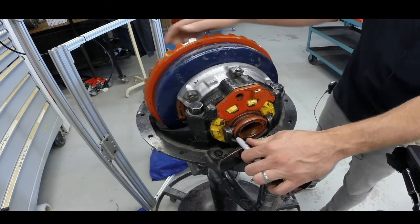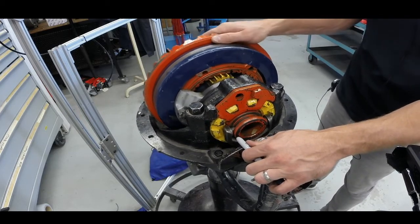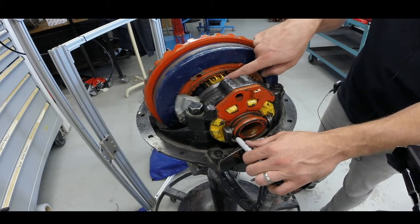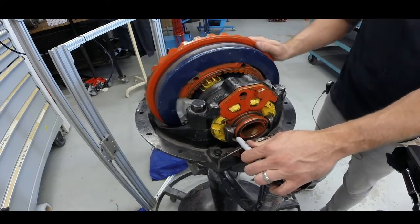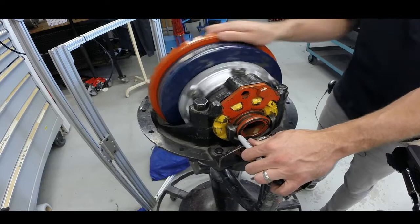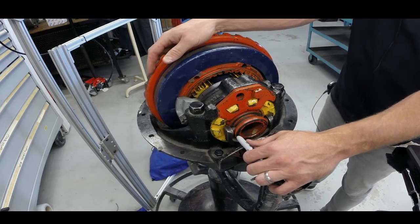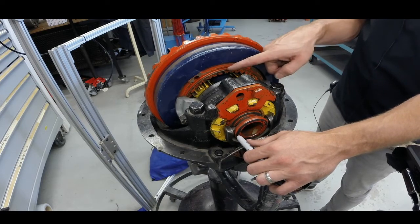I'll rotate all the way around. We're back at the top of the cutaway and our mark for our carrier and our pinion gear are gone. If we just keep rotating, eventually they may come back to us. What that's showing us is that in our low gear of our planetary two-speed, the carrier being the output rotates independently of the internal.